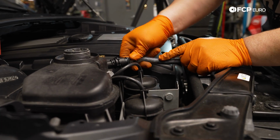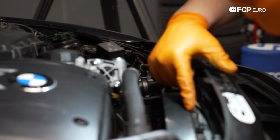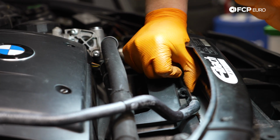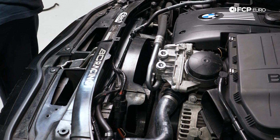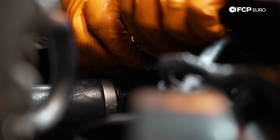Let's plug this side in. Beautiful. Two little tabs here at the shroud. You can push your hardline portion of this expansion tank line in place. Now we can attach it to the upper radiator hose, which is where it broke initially. Don't forget to put your clamp on before, or you're gonna have to pull it back off after. Get that nice and snug.